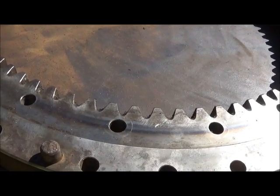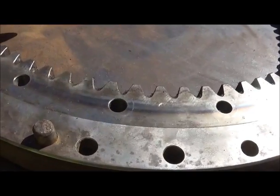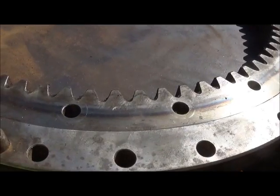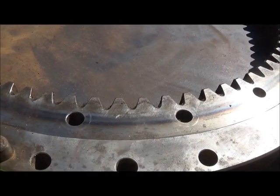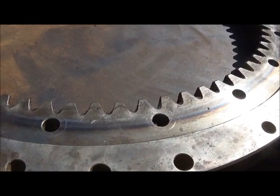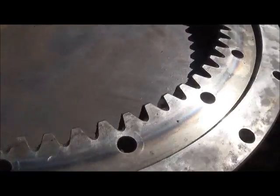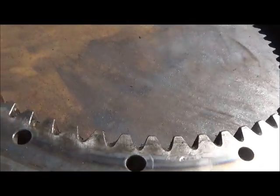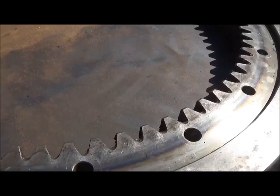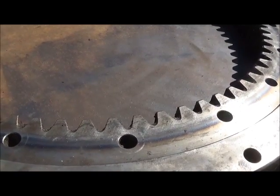One of the other things I wanted to say is you can see we've got 20 bolts running around this thing just on the inside. Our original wrecker boom setup only had six on the back and six on the front — that was 12 bolts. But really the six back ones were the important ones, that's where it's pulling up and pushing down on the front. So there's no reason why 20 good grade-eight bolts is not going to hold this fine. We're working on the gear situation. I'm going to show you the other gear and what I ended up having to do.